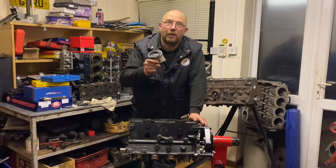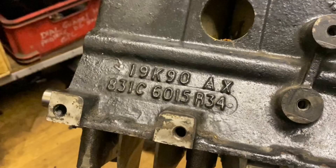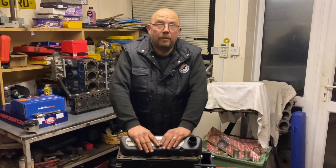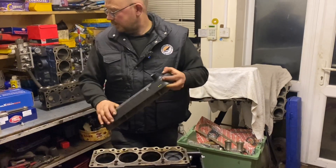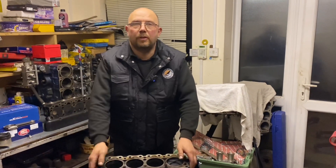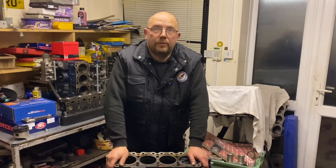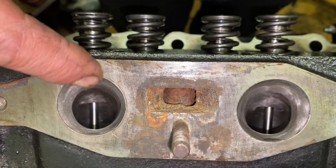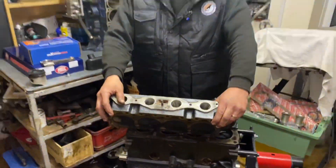Right guys, you asked for it - you wanted a crossflow build. We've not got just any old crossflow build; we've got a crossflow build in an AX block with a stroker crank, 1906cc. The engine is an AX block crossflow that started out life in a Kent 1700 Super Sprint, which means 1700cc or 83.25mm pistons. They came with a 234 camshaft, a pair of 40 DCOEs, and a modified head - ported and reworked with larger valves, ports opened up and reshaped, and thinned valve guide bosses. It gave about 135 brake horsepower.